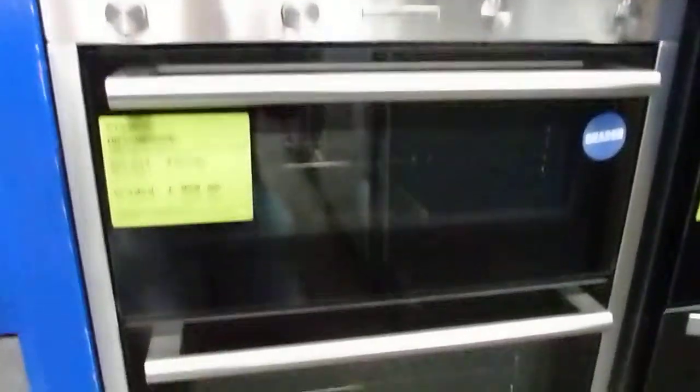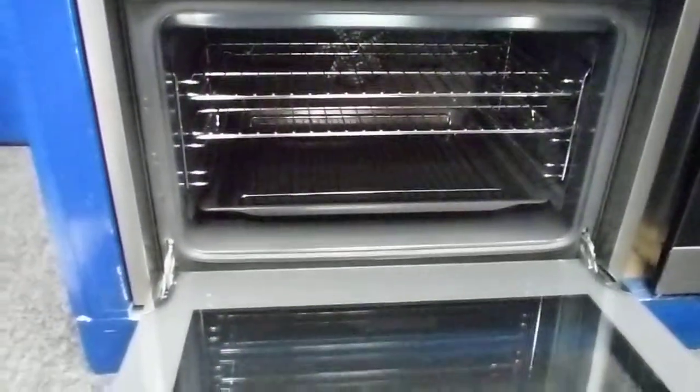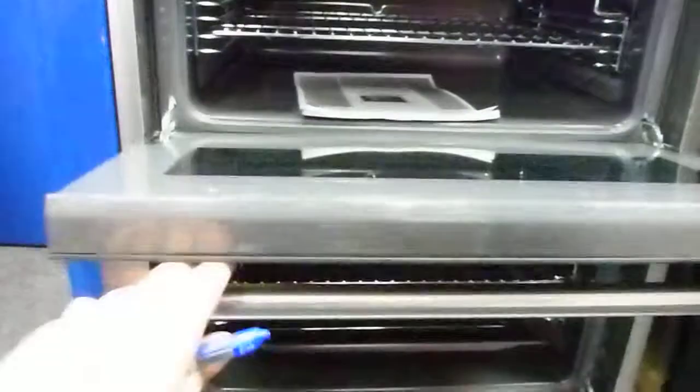You can put it in place of a single oven, but built-under double ovens please bear in mind need a 30 amp electrical supply. It won't just run on a 13 amp plug top.